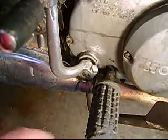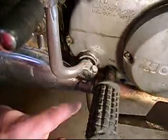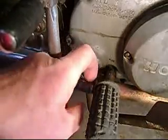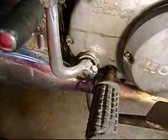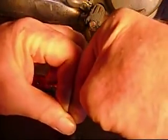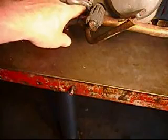And that will work on any motorcycle, not just this one. You basically have to put a larger bolt in, tap the bottom, and then grind the shaft so you've got a flat spot. Because now what happens is, see, let me pull this back just a little bit and I'll show you here. Okay. If this is the shaft, what we did was we put a flat spot on one side for the bolt to go through. So the bolt comes through, it actually locks the shaft so it can't turn anymore. This makes this unstrippable. Okay.